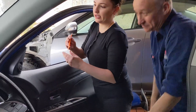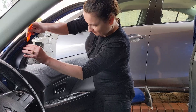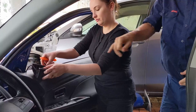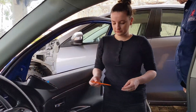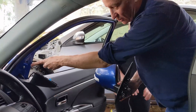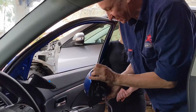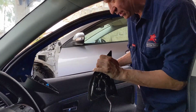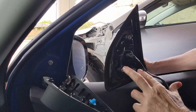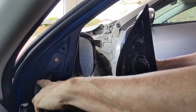First job over to you, Rachel. So just here? Yep. Very good — just place that off to the side for now. Now you'll notice that behind here there are three bolts. I know from experience, because almost all cars, these are 10 mil. Those three there — you can probably only see the top one. There are a second and third bolt and they're below the door skin line.